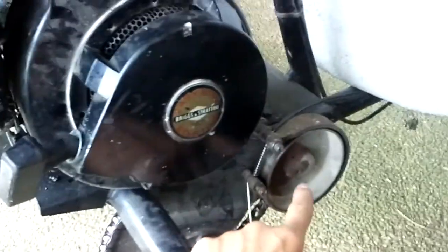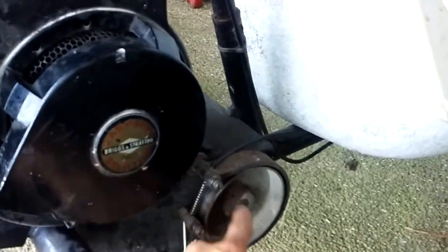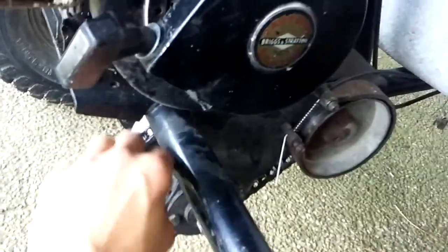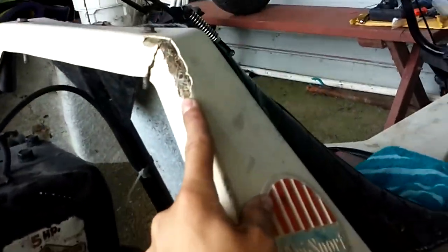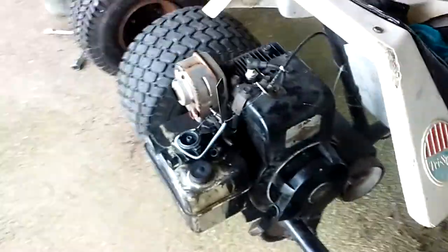This one, the brakes are hooked up, but since they're on the belt drive shaft, this shaft links the belt with the chain here to the rear sprocket. So you can stop that drive shaft, but then it's going to keep rolling. So you will slip your chain every time you pull that brake lever. They're from the 1970s. They all have wear and tear. I'm not really worried about what they look like, because obviously they don't look the best.